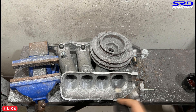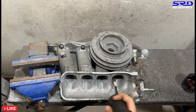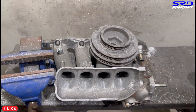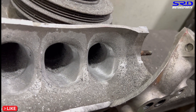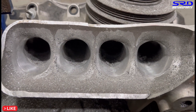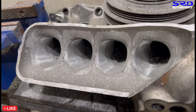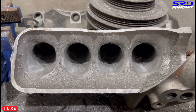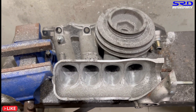It's starting to look really, really good. Let me unclip the phone to show you closer. Would you look at that — it's starting to look good. Of course the flared section is still carbide, but the runner — the initial entry or first two inches of the runner — is tapering really, really good. That will serve as a guide to the flared entry and to the rest of the runners.